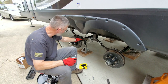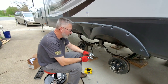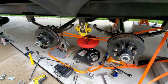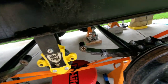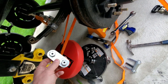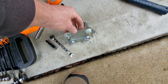I've got jack stands underneath the axles themselves, so we've taken the weight off the axle straps so we can get these out, put the new ones in, and get everything retorqued. During disassembly I found out that the Road Armor equalizer, if you have shackle straps that are two and a quarter inches and this is a 35-inch center-to-center axle assembly, you will not be able to use a two-and-a-quarter-inch shackle strap — it's just not going to make it. So I had to order three-and-one-eighth-inch shackle straps. You can see here the difference in these.